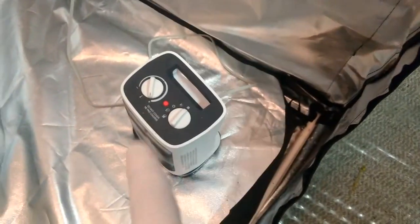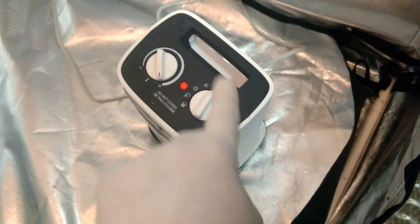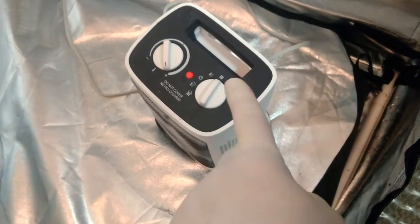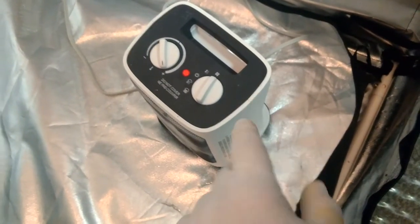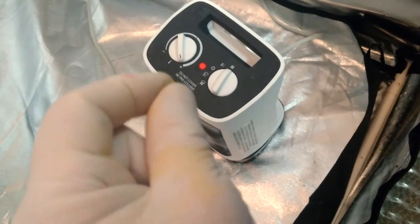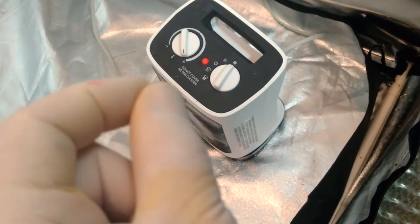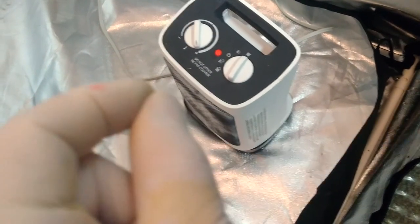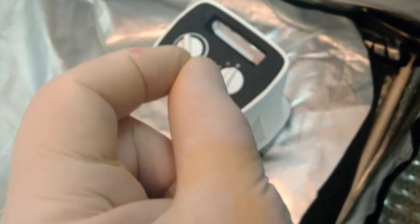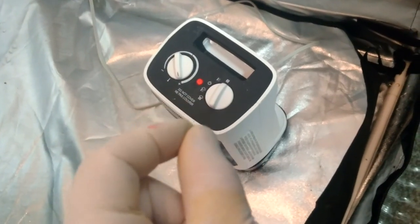I plug it in. I don't worry about that temperature setting because the temperature setting on these always screws up. Don't buy one of these and expect to use that dial, because it won't work for you. It's going to get locked on hot — that's what normally happens. The contacts in there, when you keep them on one spot for too long, they melt and fuse together slightly. When you turn that knob again it'll change, but here's what happens: your room that was supposed to be 26 to 28 degrees is now 40 — and that's what happened to me.